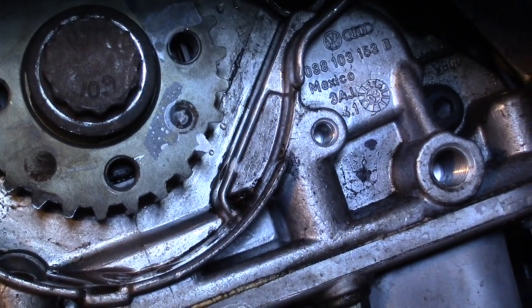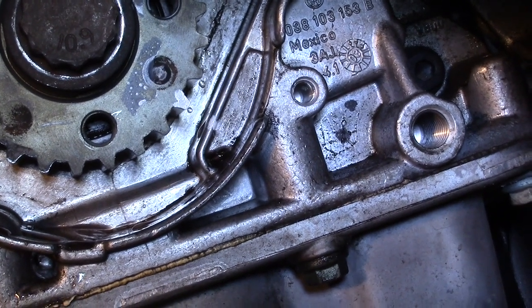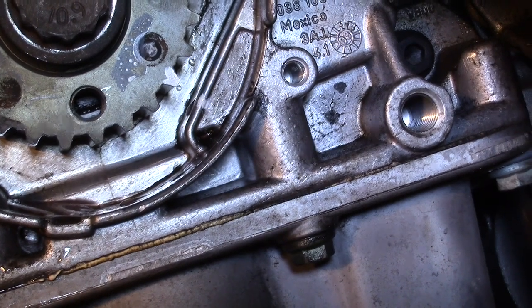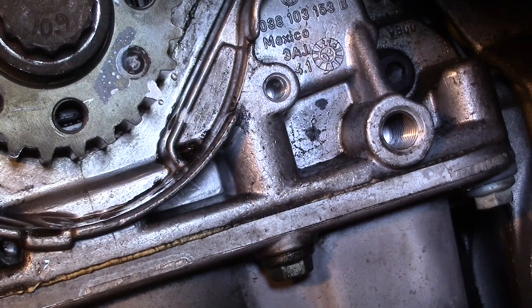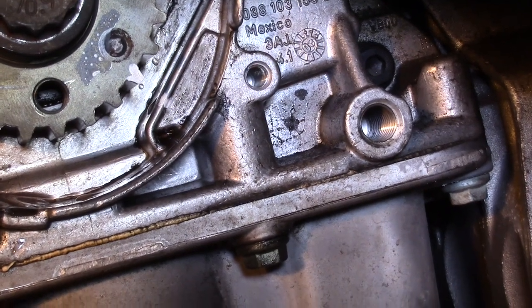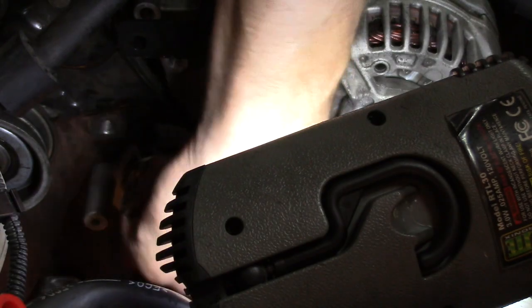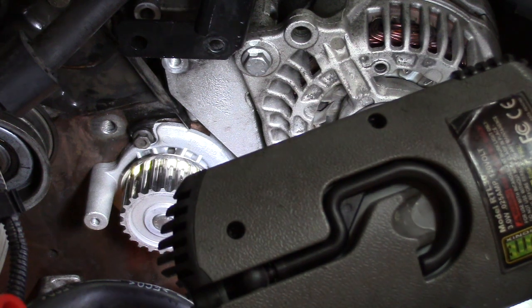A better way to confirm TDC is the crankshaft sprocket — I have made a white paint mark for the alignment to top dead center on cylinder number one, which makes more sense since that's where I'll be working with the belt. Notice on this model there does not appear to be any factory indication for top dead center with the crankshaft sprocket against the oil pump cover — that's a little unusual, first I've ever seen that on a vehicle — but this is what I'm going with for my top dead center mark.